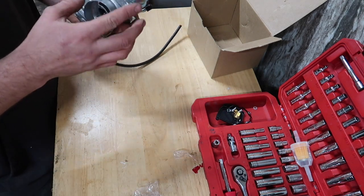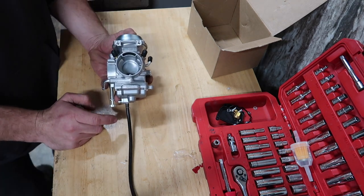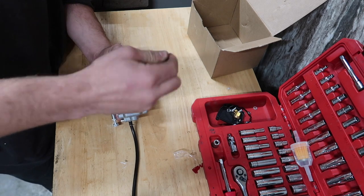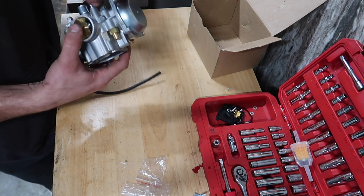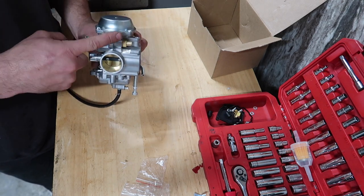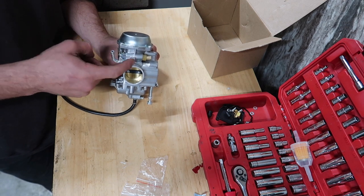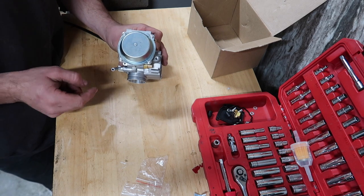Now that the carb is off the bike, for subscribers using these King Quads — these right here with the caps on them are your overflows. These two brass ones are your fuel inlet. This right here is your vacuum line. On the Suzuki you'll have a plastic vacuum line up in here, but this one doesn't have it. So if you have that secondary fuel pump on your petcock and haven't bypassed it, you won't have a port for that — you're only going to have one barb for the big fuel pump.